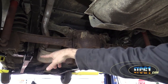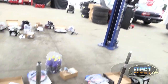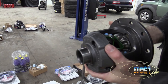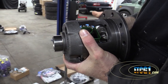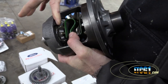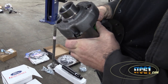I also have all the rear suspension parts — the upper and lower control arms. With everything you see down below, this completes the rear end. This is the differential, and this is what I was talking about — whether it being 28 or 31 spline. This is a traction lock Ford Racing differential. There are clutch packs in here, and when I take the old differential out, I'm going to disassemble it so you can see all the stuff that's inside it.